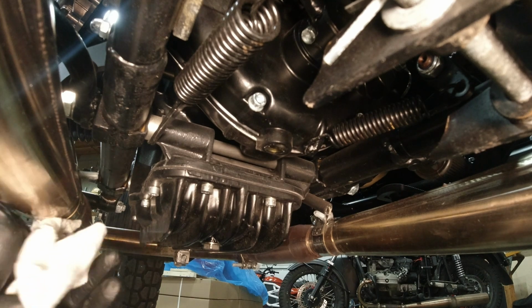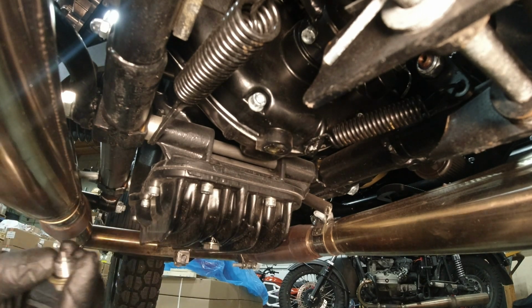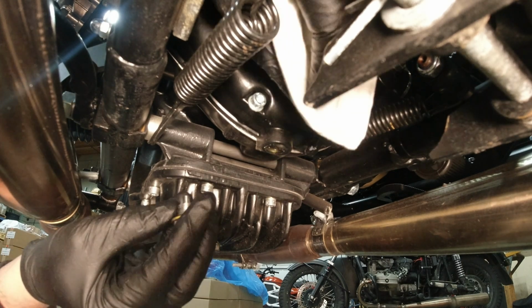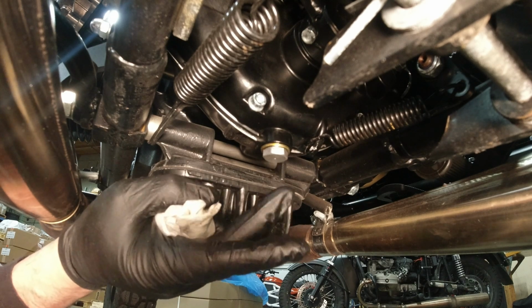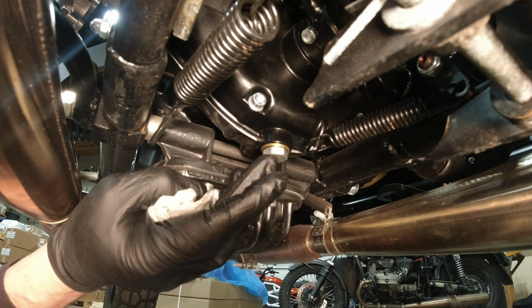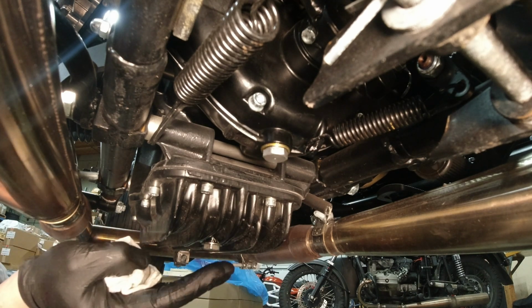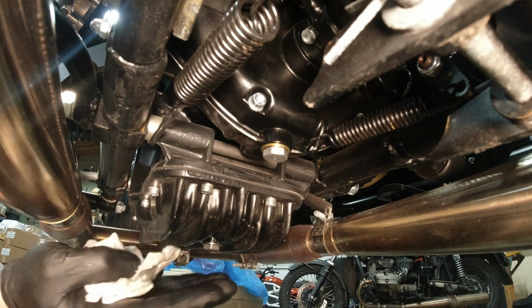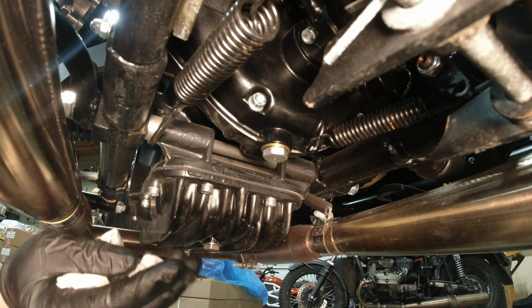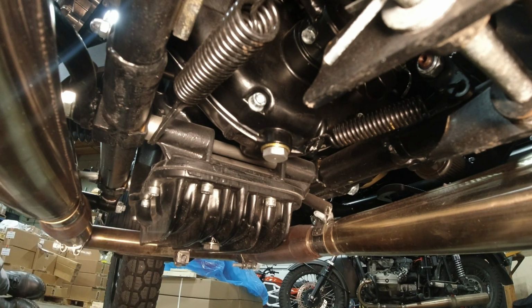And after a while, you'll be able to wipe this and get the drain plug in. Tighten this up and then torque it to 22 Newton meters or 16.2 foot-pounds in the United States. Or like I do, I just go 16 even. And if it needs a little bit more, then I do that later, but most of the time 16 is fine.